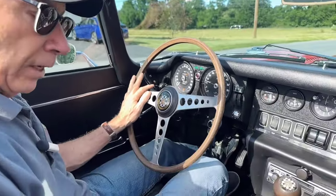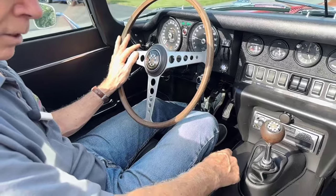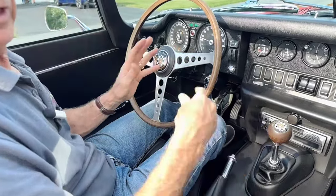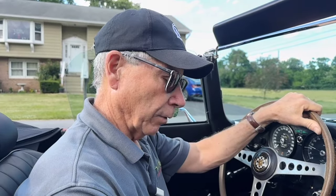Also, the parking brake is not working on the car — it comes the whole way up but it's not working. The reason is it needs the rear shoes replaced on the rear calipers for the parking brake. That does involve dropping the rear subframe, which to a Jaguar mechanic is quite straightforward on these cars, but I want to mention that because if a parking brake is important, it does need that work done to make the rear parking brake work correctly.